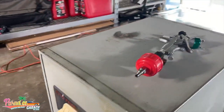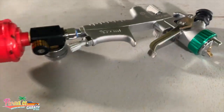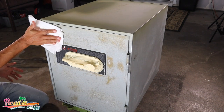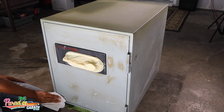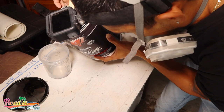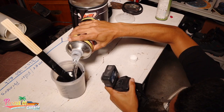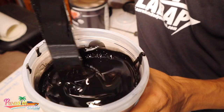We're going to be using the Atom X27 low volume low pressure paint gun, which is great for someone with a small air compressor setup at home. I was running a little 30-gallon belt-drive air compressor. A low volume low pressure gun lets you spray at a very good PSI — around 24 to 25 PSI — while using less volume from your compressor.